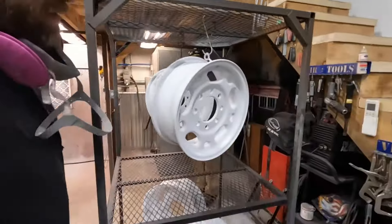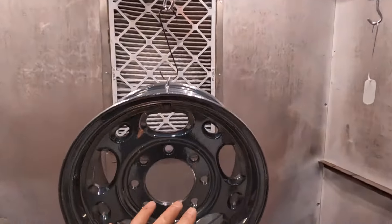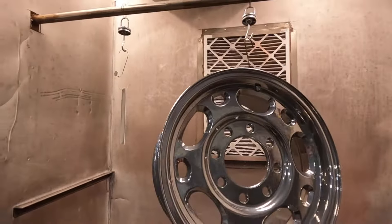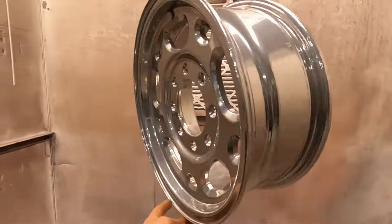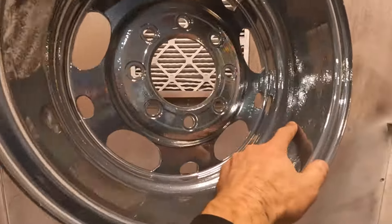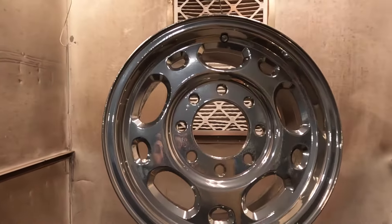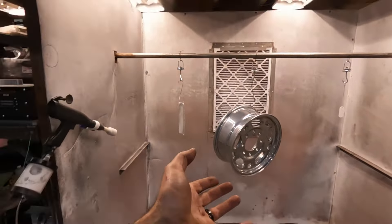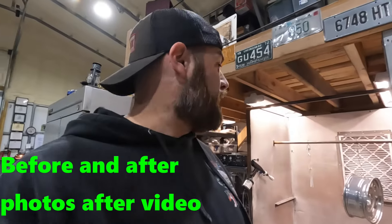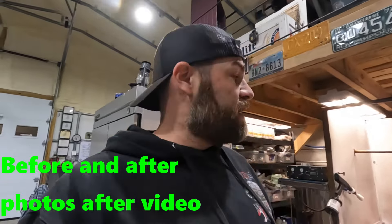Hey Steve, did the customer want white wheels? I hope so. All right guys, here they are — completely done out of the oven. That's outgas primer, that's the Chroma Chrome, and then the final touch is the wheel clear. And they still look pretty rad, honestly. The clear does dull the chrome shininess a little bit, but all in all, the wheels came out nice — he's going to really love these. I'm happy with them. Any place you have pitting, you're going to see that no matter what you put on them, but the wheels are miles ahead of what they were. So that is the Columbia Chroma Chrome powder coat with the wheel clear over it. We use mostly Columbia Coatings powders here, and we've had great luck with their products. Thanks for watching and thanks for hanging with us — it's been a nice little powder coating video. Scott, Flippin' Customize.